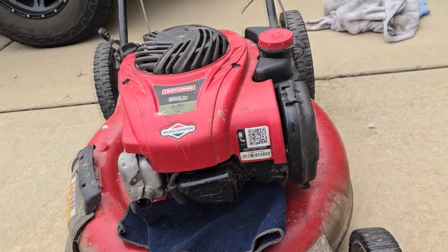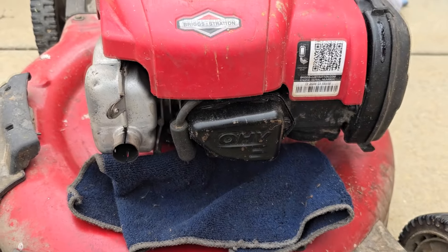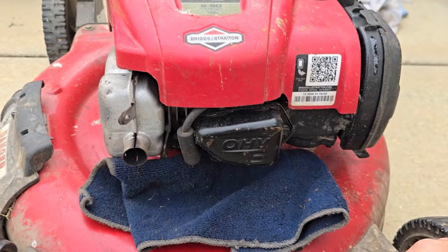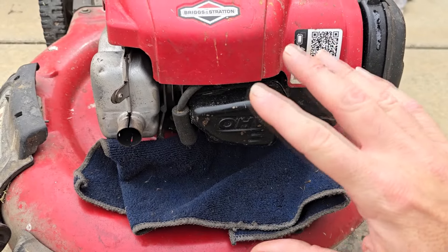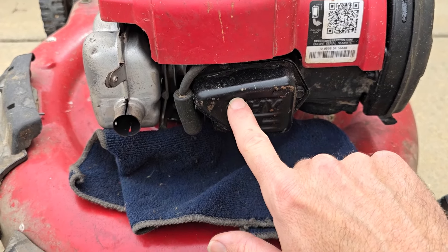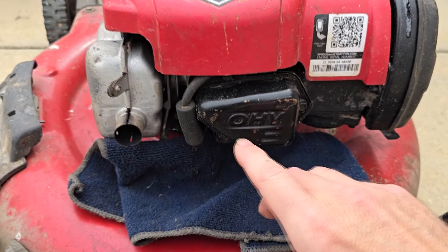What it wound up being was a couple of things. First and foremost, my exhaust valve was out of adjustment. Some videos — and Chick Canik has a really good one — mention checking your valve lash before you tear into the engine and buy a camshaft and all that. I didn't, because I was sure it was a camshaft. I was incorrect. The camshaft was fine. I took all that apart and put it back together for no reason, then checked the valve lash and found out I was at probably 17 or 18 thousandths on the exhaust valve — way too much to allow that little compression release gizmo on the camshaft to activate the valve.